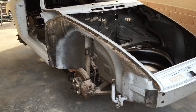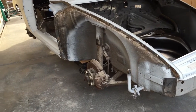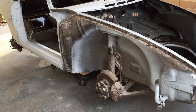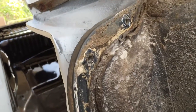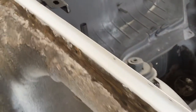If you're pulling your fenders off, this is a pretty easy job. I didn't even have to pull the wheels off to do this. You just want to turn your wheels so you can get a 10mm socket on the inside of the fender. These are going to be from the inside of the fender. I think I need a 6 or 8 inch extension — I just used a quarter inch drive. They're not tight; none of these bolts are tight at all.